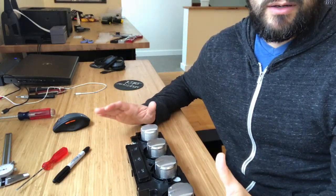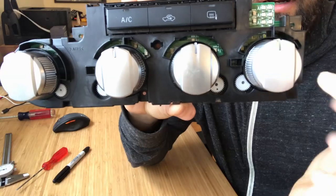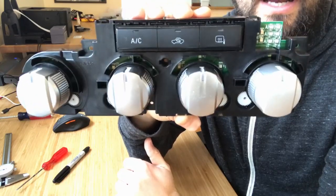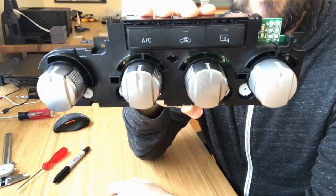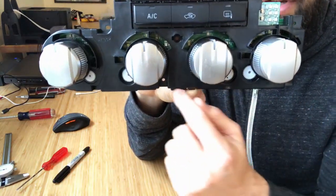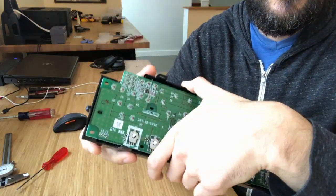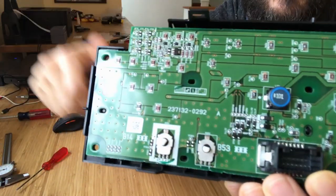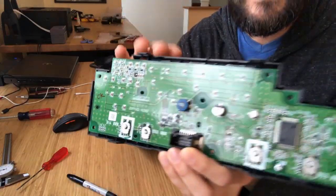Adam with AJT Design here with a little supplement to the video, mainly regarding the position of the white gears relative to the knobs during disassembly. What I highly recommend: once you get this out of your truck, turn all the knobs up to top dead center — same procedure whether you have a second gen or a third gen with three knobs. Note the positions of those white gears, take a photo with your phone, take a sharpie and mark them. There is a little flap that will be turned to a specific position — mark everything before you take it apart.